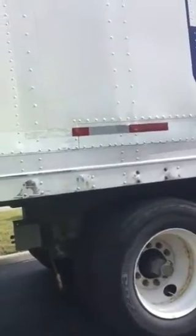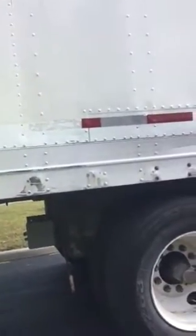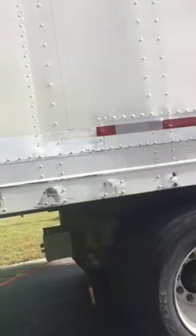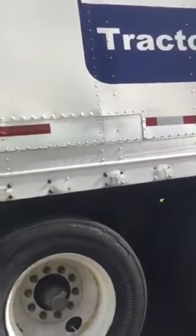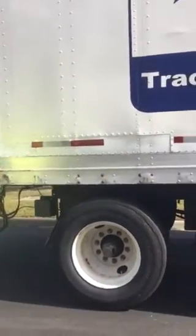My suspension system: my forward and rear spring mounts and U-bolts are not bent, cracked, or broken, missing nuts, bolts, or screws. My leaf springs are not bent, cracked, or broken — they're properly aligned. Any more than a quarter of a leaf missing would place this trailer out of service. My shock absorber is not bent, cracked, or broken, missing nuts, bolts, or screws, and I see no leaks. My airbag mounts are not bent, cracked, or broken, missing nuts, bolts, or screws. My airbags are not cut, cracked, dry rot, or bulging, and I hear no leaks.